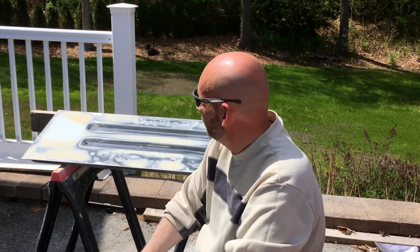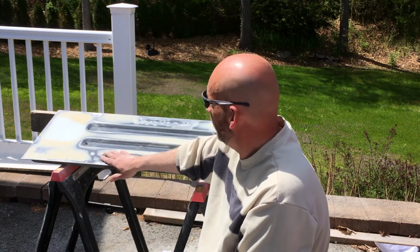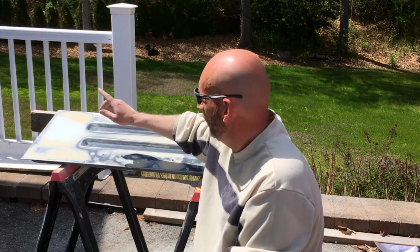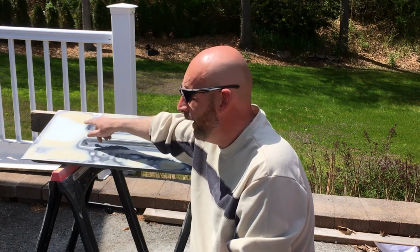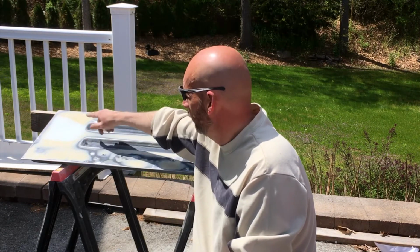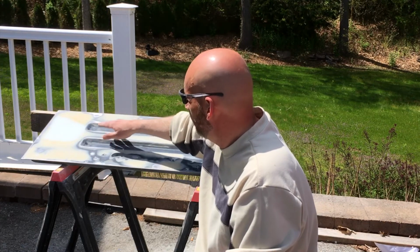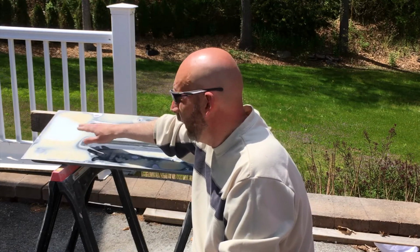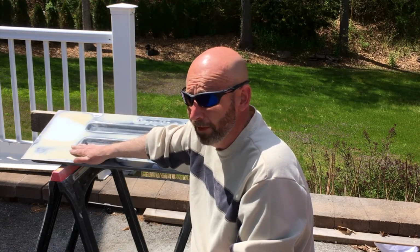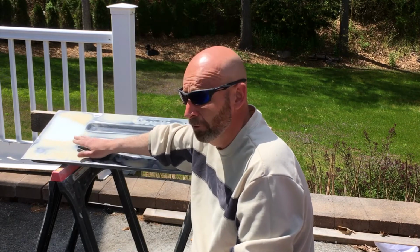Okay, I'm back. So I just want to do a quick review, 2 seconds. So this tailgate has gotten, let's say, a plate welded. It has Duraglass, fiberglass on there. Has gold filler through the whole tailgate. Then on the scratches and the little divots I found, I used a putty. The putty dries really quick, like 3 minutes. You know, like starts drying. So only make a little bit at a time.